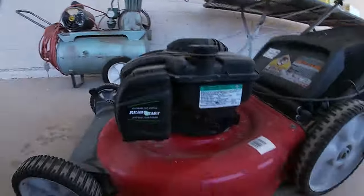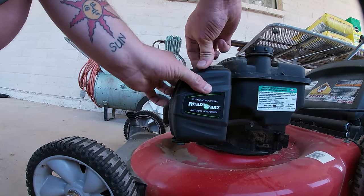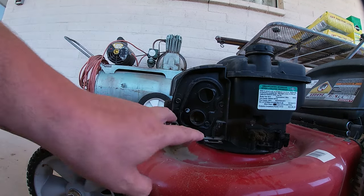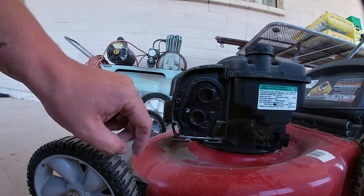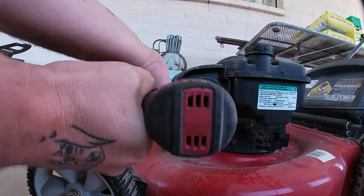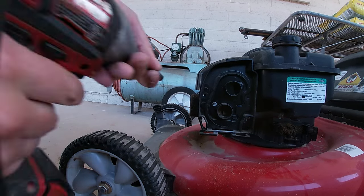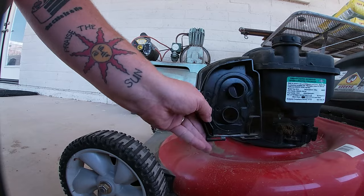We'll start carefully by removing the air filter. You can buy these air filters — sometimes they have the foam one, sometimes this style — you get them at Home Depot or wherever your nearest place is. Looking at it, I know these two bolts are the 7mm, which are also on the carburetor. We're going to start with the two 8mm bolts — the two eights hold it to the frame, the sevens hold it to the carburetor. Eight for the frame, seven for the carb. There's the two eights off, and now four sevens to go.